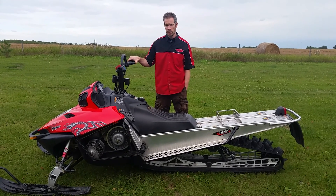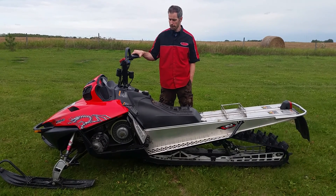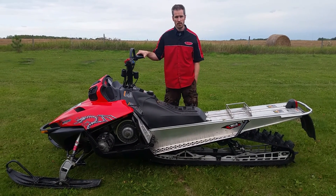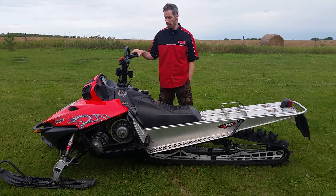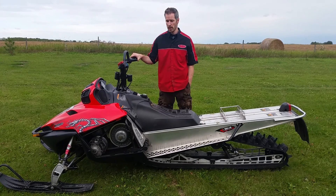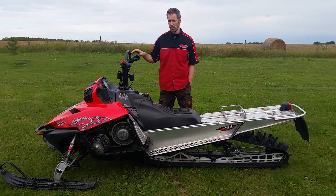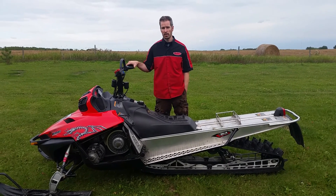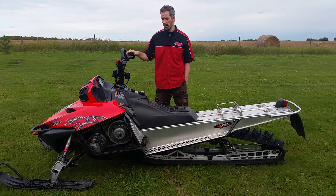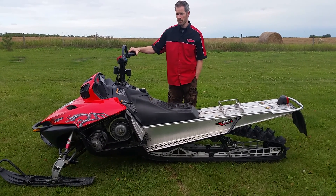We put our Redline Engine Performance Force Induction Tuner FIT H401 on here. We've developed some software that can map out the engine really accurately and give you a really good map to start with. So if you've got something really weird you want to put it on, we can do a lot of calculations and get a great starting point. That's a big problem in the industry — not knowing the calculations behind all the controllers. Having a mechanical engineering background finally paid off.